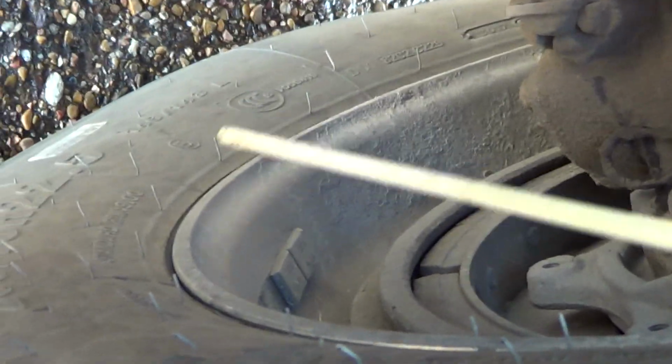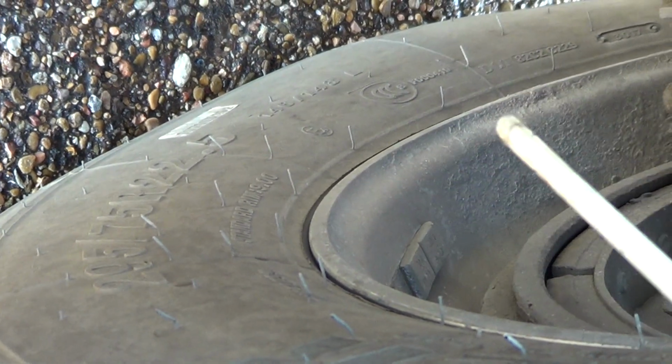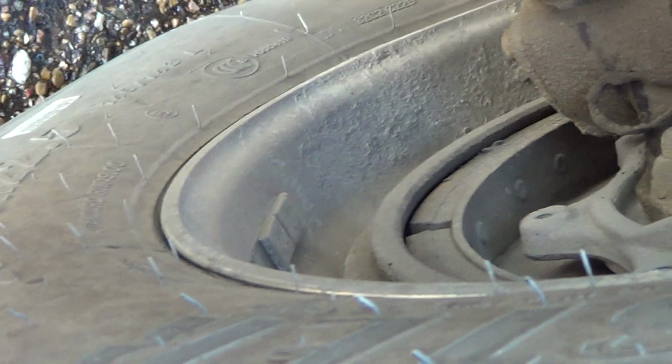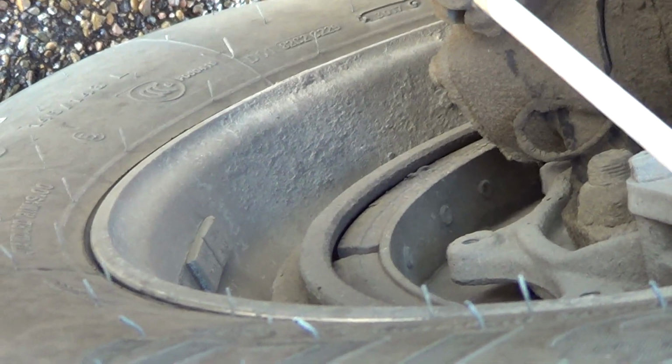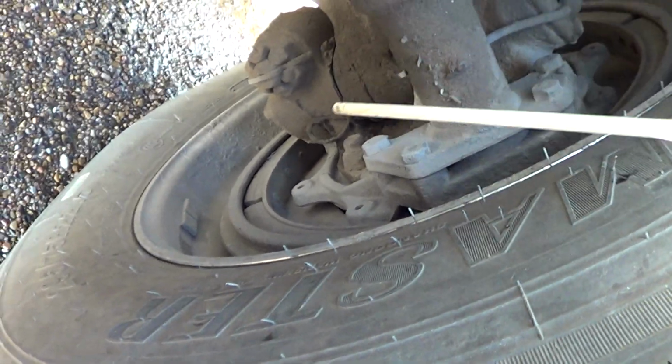From our brake lining, we go to our brake drums. Our brake drums are not bent, broken, or damaged. They're firmly attached to the vehicle. No illegal welds. We should not have more than 1 inch of heat-related stress cracks in our brake drums. And that is it for the brake system. After our braking system, we go to our wheels.